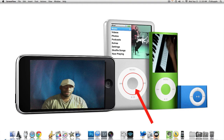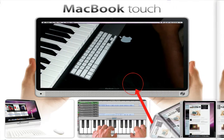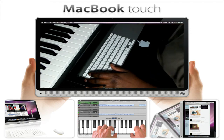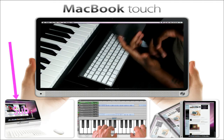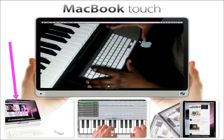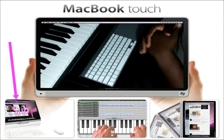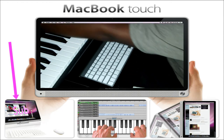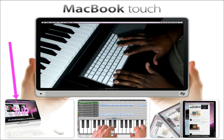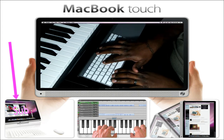I'm going to go ahead and switch cameras so you can see what I'm doing — we're going to jump into it. All right, YouTube, it's your man, we're back. You can't see my face, but you can see my hands and my keyboard and some of my setup. So basically what we're going to do — we're going to take a little minute but it's cool, we're going to clean everything out. You want to turn your computer on, then hold those keys down: Option, Command, R, and P. Hold them down.